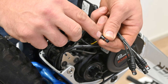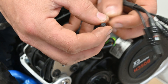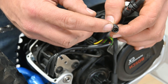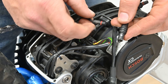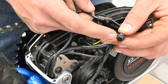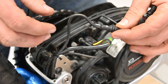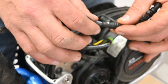You can see here we've got white on the top, a flat edge in line with that white and then four little pins. If we get the E Plus connector and find the one that has four little pins inside, you'll notice we've got a white mark on the top of it. That is to line up with this white mark here. You can double check by looking inside and you'll be able to see where the flat edge is inside the plug. You want to just carefully clip that in there. Make sure you check this so that you don't bend any of the pins inside these connectors by trying to put it in the wrong way.